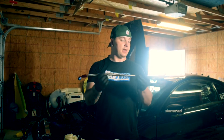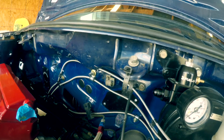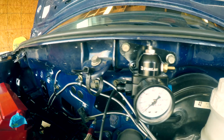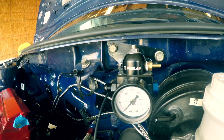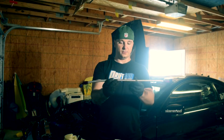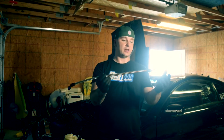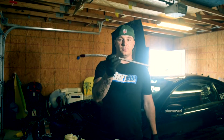This is pretty much how it's going to be set up. This is the line I made that goes from my fuel rails to my fuel pressure regulator. Speaking of the fuel pressure regulator, I have a Fuel Lab miniature fuel pressure regulator — one of their basic ones. It has dash 6 endings with little unions so I can hook straight up to it without any barbed ends. I made this line when I did the swap originally, so it gives you an idea of what it's going to look like — just a shorter version of the tank-to-front-of-car run.